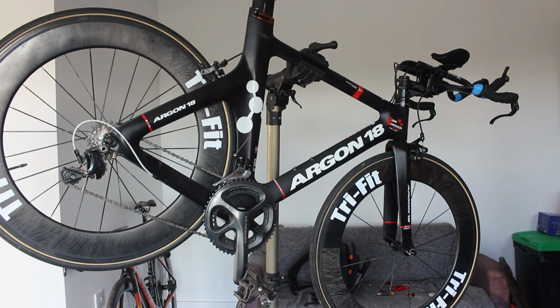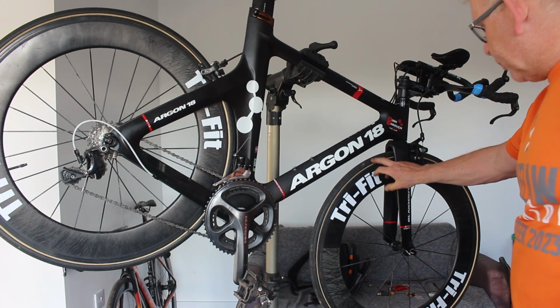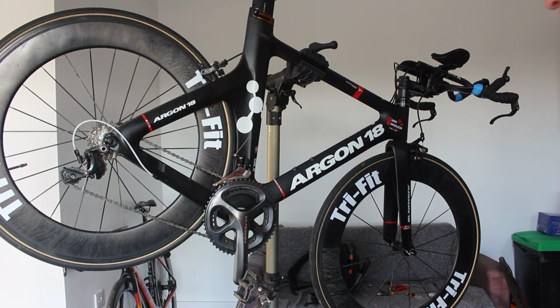I've stuck a new inner tube in, that was the one that came down to, they couldn't get the tyre off, and it turns out it was a tubeless tyre, even though it's not a tubeless rim. And it doesn't sit right. I think it's been sat outside the rim, and it's been bulged out, and it's been rubbing on something, and it's worn all the sidewall out. But anyway, that's another story. That's not even going to get on camera now, and it's not worth it.